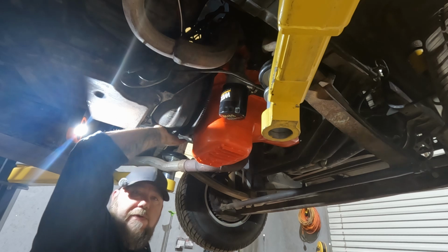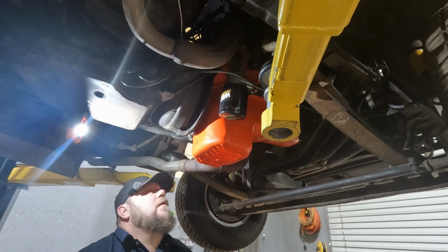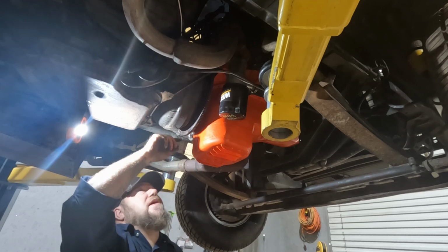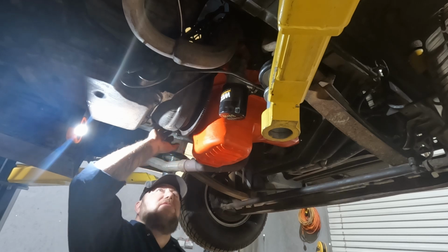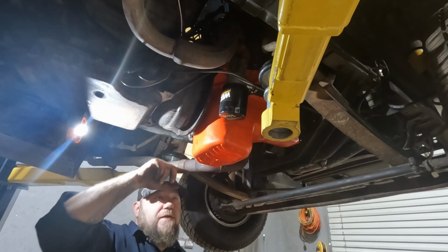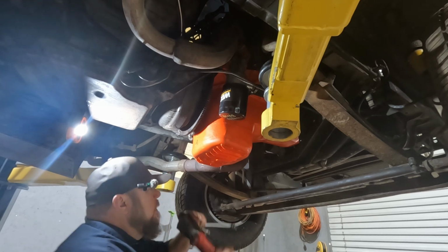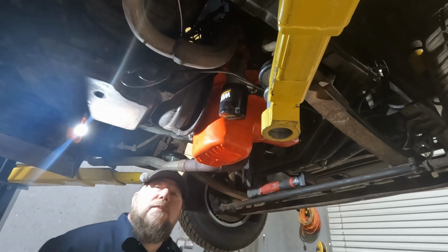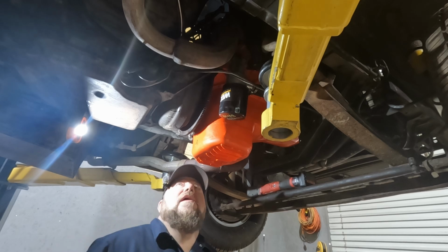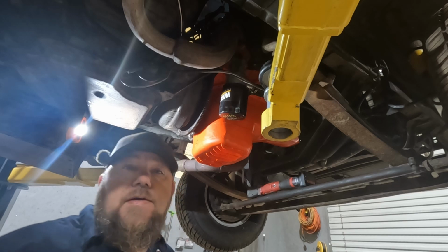So I didn't tighten those bolts. You want to start all three of them. What'll happen is you'll tighten the bolts, and then when you go to turn the engine over to the third bolt, it won't quite line up. It'll be really difficult or impossible to start. So I'm going to turn this engine over by hand, start the third bolt, and get them all tightened down. I think we got to tighten an alternator belt and put some fluids, and be ready to start this.